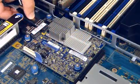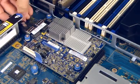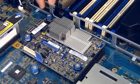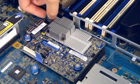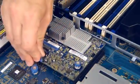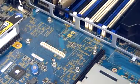Disconnect the cables from the board. Loosen the three captive Torx T15 thumb screws that secure the board to the chassis pan. Pull the board straight up off the system board and remove.